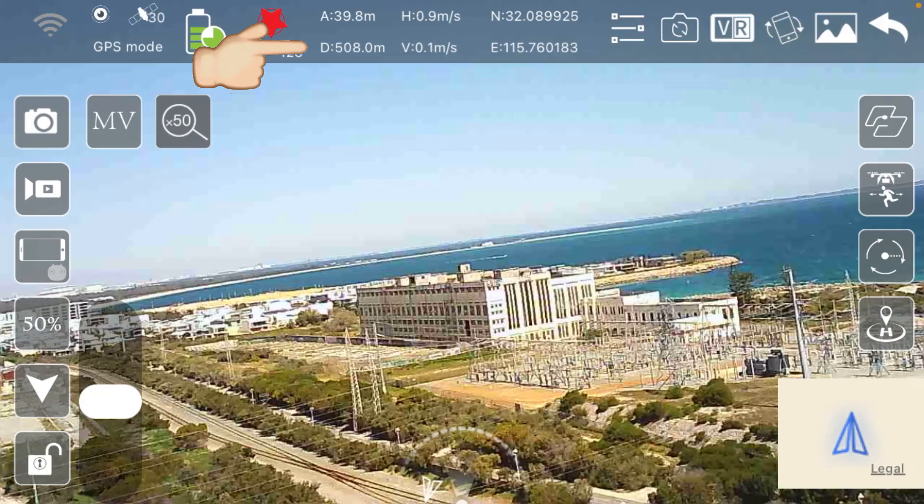I'm giving it a chance to reconnect — not really pushing the drone forward, just seeing if we can get that connection again. Trying to push forward — the transmitter telemetry is saying 511 meters and it won't go any further. So it's got a 500 meter distance limit built in, and we're not regaining any FPV.